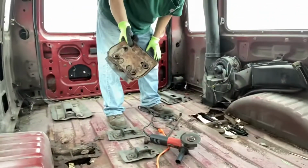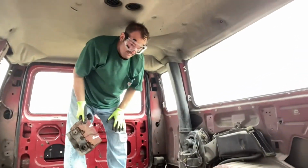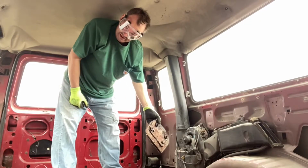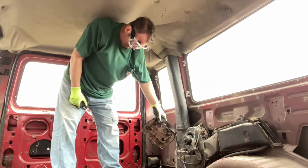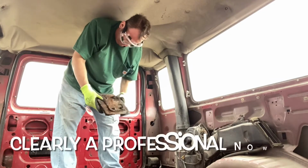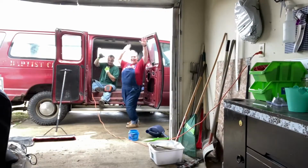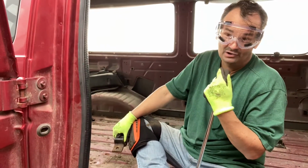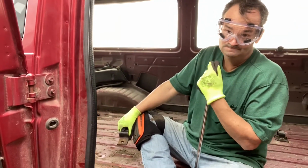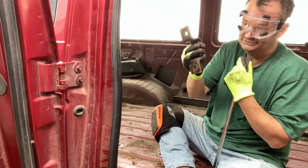Breaking news. Boy, that was a pain. That whole big square out, be careful if you cut over here, because that's where your air conditioning lines and your heater for your back fan, all that stuff is right there. If you go a little bit too deep, you'll slice one, and then you've got water leaks and all kinds of stuff. If you're going to do this, try to buy a cargo van, like a plumber's van or electrician's van, that's just open in the back, and then you won't have these problems. This is a 15-passenger van full of seats and foot track.